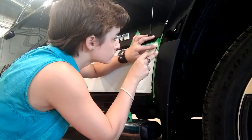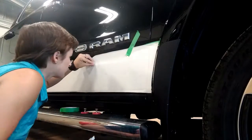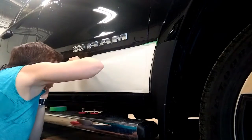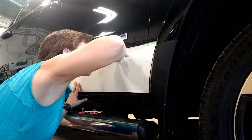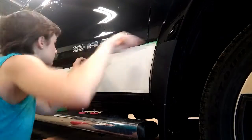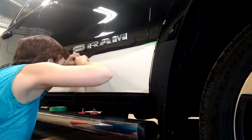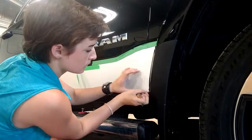Snap my blade, make sure it's nice and sharp. If you're going to trim on a truck, especially through chrome, you have to have a sharp blade and you have to know how deep to cut. You always run a finger over your cut line. I'm running a nail so I have a nice clear line to run my blade. I even have a little piece of tape there to help keep it straight at the beginning, and then I do it in one smooth motion. I try my hardest to make all the cut at once because then you won't have any wobbles or starts and stops.